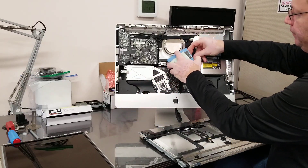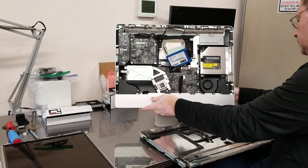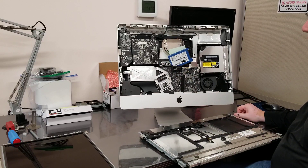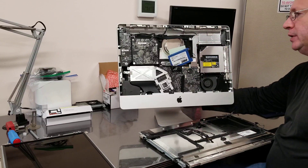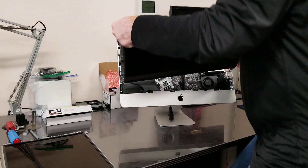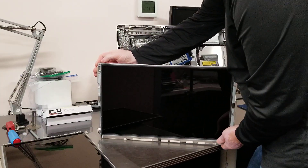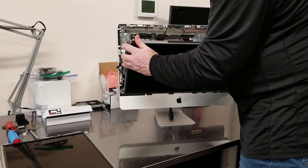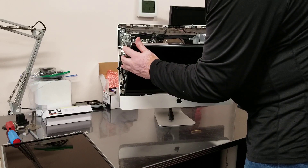Let's get the hard drive connected. This is an SSD hard drive. Let's plug it back in. It goes through the checks, it does the beeps, but it wouldn't start. The screen shows no hard drive present. Now let's get the screen connected. This one is a little more involved, plus it's upside down. I don't know what's up with these Apple computers and screens.